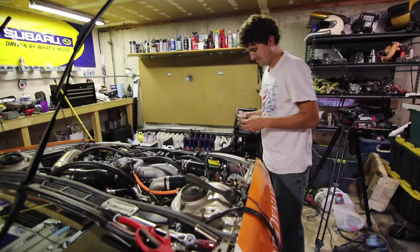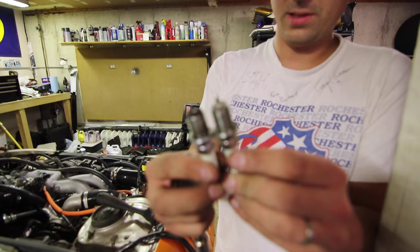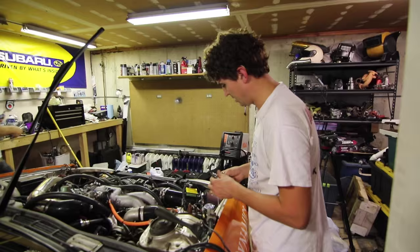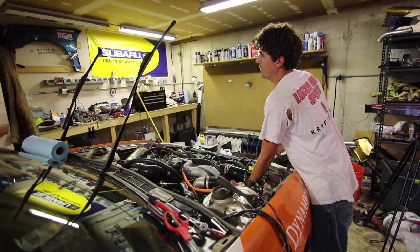You can see that's definitely not sparking. Cylinder 3 — there's a cylinder 1. Check the power wires. Just ground it so it sparks from there. If not, move forward.